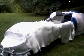Fiberglassing the body. To fiberglass the body, we chose an 8.5 ounce fabric from ThayerCraft.com, style 7725. This bidirectional twill fiberglass fabric has a Volane 504 finish that can be used with any resin and has excellent drapeability. This fabric really was very easy to work with and flowed very well, even around the sharp edges on the rear section of the body.